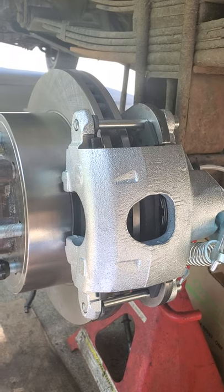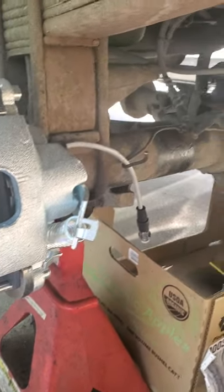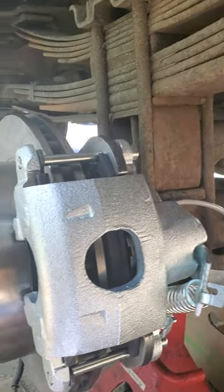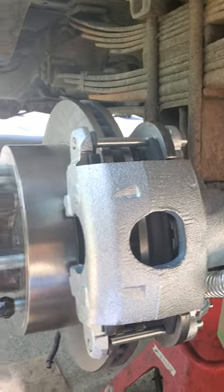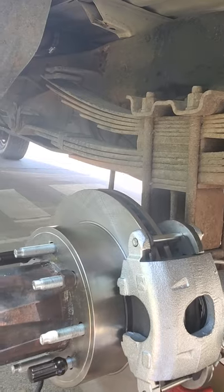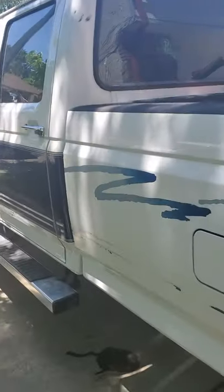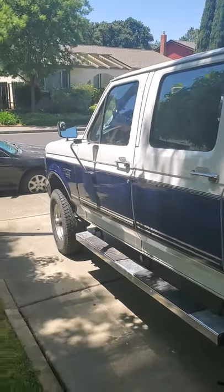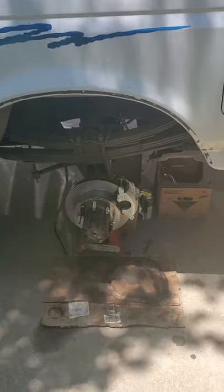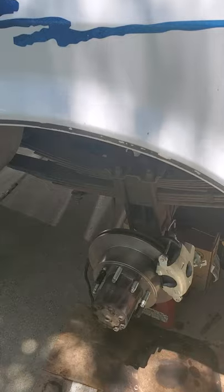Once I get the proportioning valve, I will make a video after it's all completed. I'm not going to go through step by step because there are other videos covering the majority of the steps from people more knowledgeable. I'm just showing you my setup — when I was trying to put this together, there was no video or reference out there. So here's what it is: if you have an old-body-style Ford F-350 or F-250, you want to buy one of these disc brake kits for the Sterling axle. I got mine from CP Attic, and there are other places out there selling them.